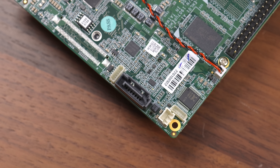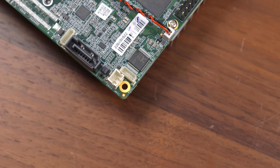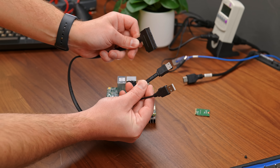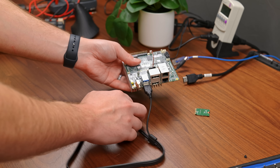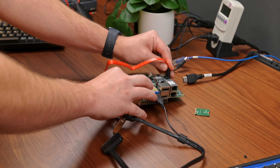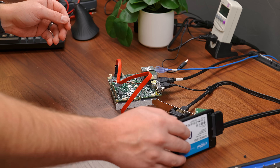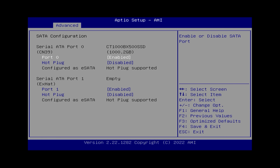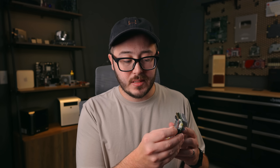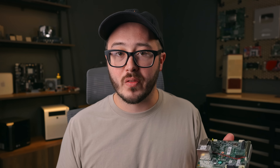Another storage option is the SATA port, but it uses that odd little 2-pin power connector and there's no cable in the box. What I did have was a little USB adapter for SATA power, though that's designed for eSATA, so I also needed an eSATA to SATA adapter — and sure enough, that worked just fine. So you could use USB power or try to crimp your own little power connector, or possibly buy one from their store.